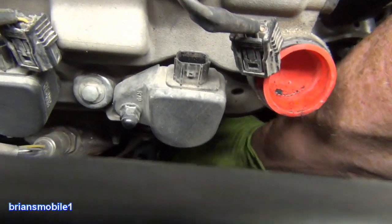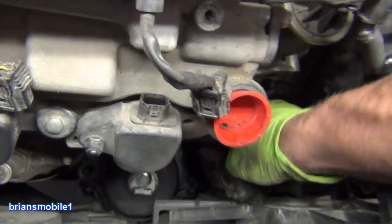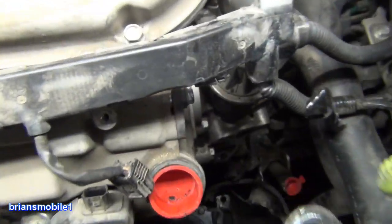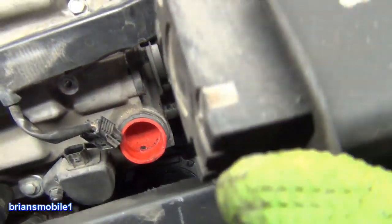Because there was an interruption due to the memory card, I never talked about the dampener that's in here. Normally you just pull the dampener out — it's just a couple of 12mm bolts. You want to take those out — I just use really long extensions and get it out of the way. You can just kick it off to the side, you don't have to pull it out all the way, but you should unbolt it.